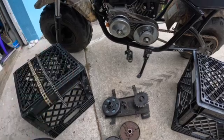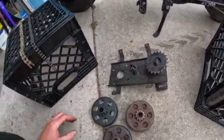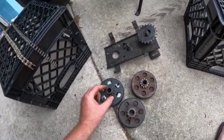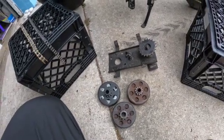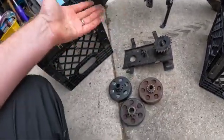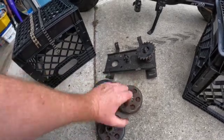There are a lot of different clutches and a lot of people buy clutches, have problems, can't get them on, and it's not working right. Just like we were talking about with those two different size chains — you see 35, 35, and this is the 40 series chain. If you go online and you're just buying it for the number of teeth, no dice — it ain't gonna work. You're going to run into all kinds of problems. So you want to look at what's on the bike. If you don't have something to reference, ask around and find somebody with a similar setup. Look at their performance, ask how they like it, and go from there. Figure out how many teeth you need and what type of chain — whether you need 35 series or 40 series.